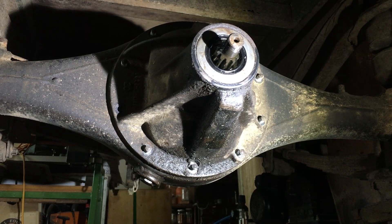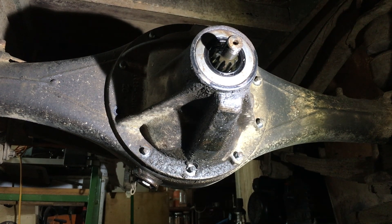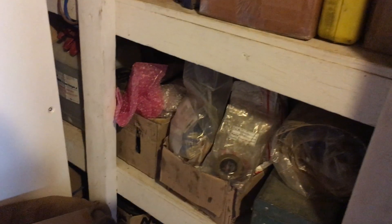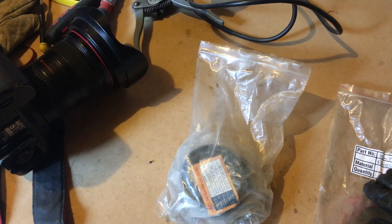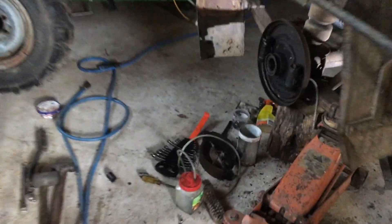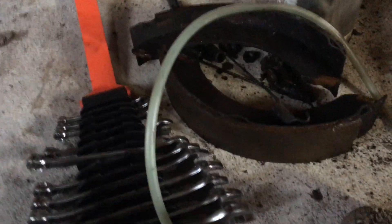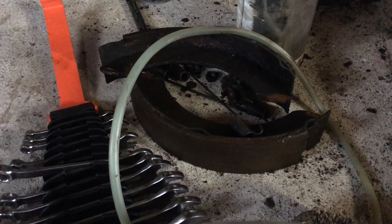The actual lash from the pinion to the crown wheel isn't as bad as I thought it was, but this front oil seal was leaking. I can see on there it's a 3874-something. Do I have a diff seal that's 3874? Here are the seals — 3874, they're the ones we need. We're going to need the axle seals too because the axle seals are bad. They were leaking all over the brakes, and the brakes are terrible — so covered, probably in diff oil. One of the pads is coming off the shoe, so I'm going to need to get some new ones of those as well.